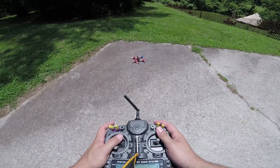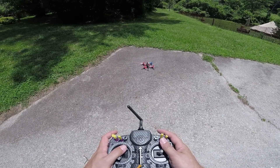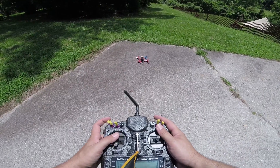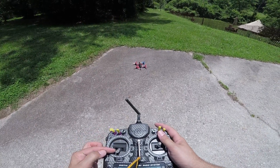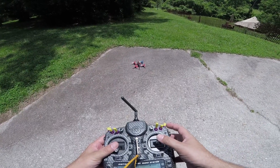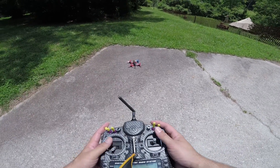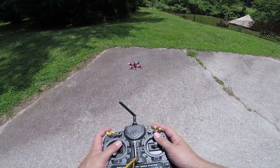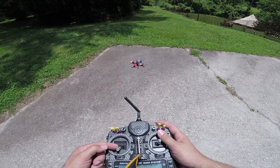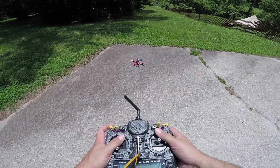Well I've figured out a way to prevent that. The quadcopter in front of you right now has three red props and one blue prop, and that blue prop is the wrong direction. What I'm gonna do is arm it, and instead of raising the throttle I'm just gonna bump the pitch and roll stick slightly. If the quadcopter is working correctly it will just tilt gently left, right, forward, back. But if anything is wrong it will try to flip out — but it won't be able to because the throttle's all the way down. That's why I feel confident doing this standing so close. I'm a little bit terrified.